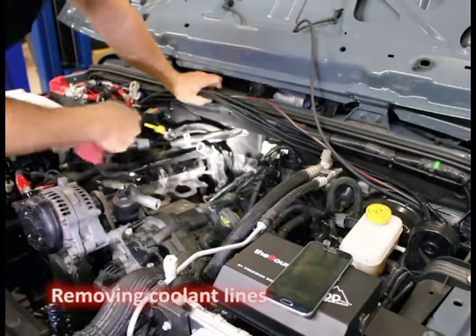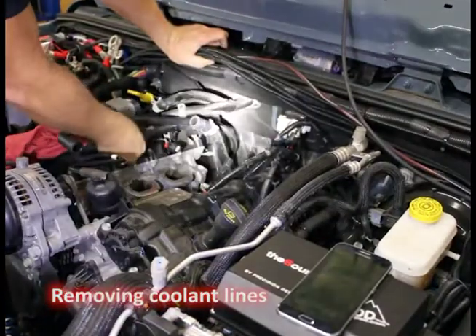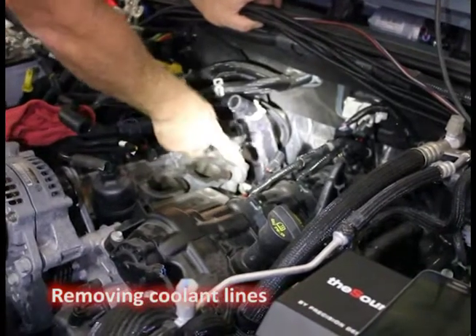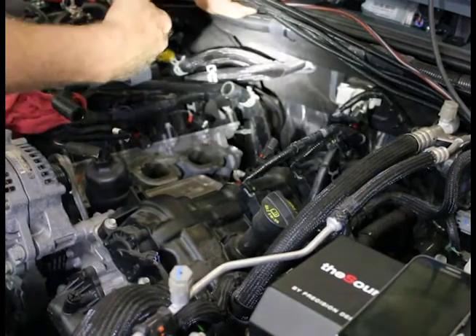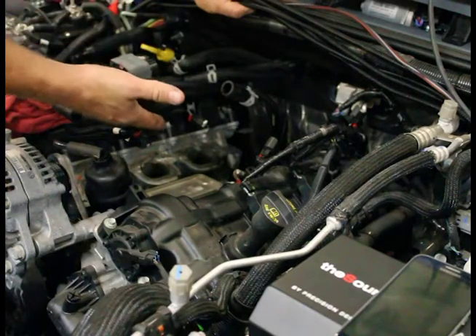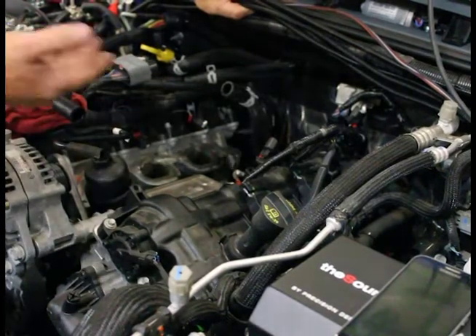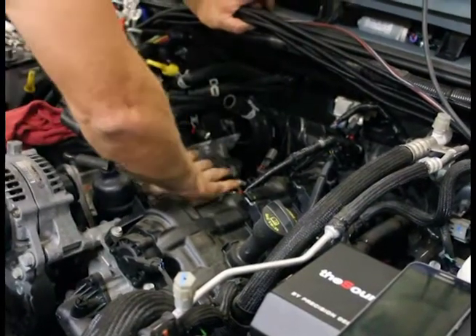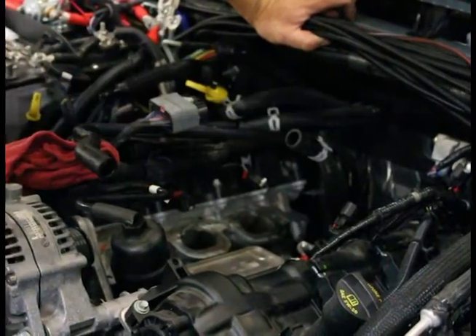There's one thing I want to point out — look here, there's motor oil right where the intake manifold was. When we put the injectors in I'll show you more motor oil. We'll flip the plenum over — more motor oil. It's pushing so much PCV and the car's only got 2,000 miles on it. This is actually getting in through here and could cause issues with pre-ignition, things like that. Just notice the amount of raw motor oil — look at that, it's a lot.